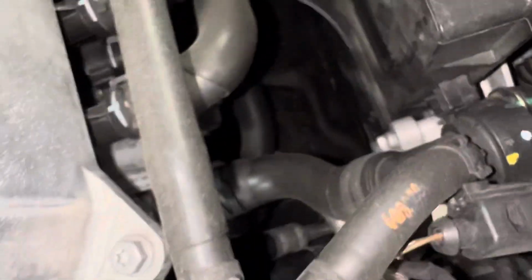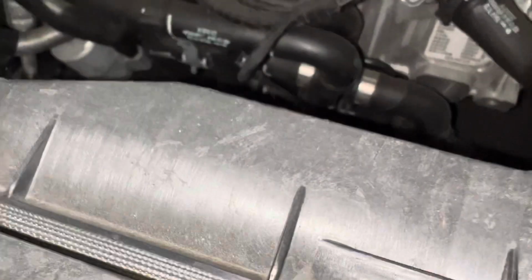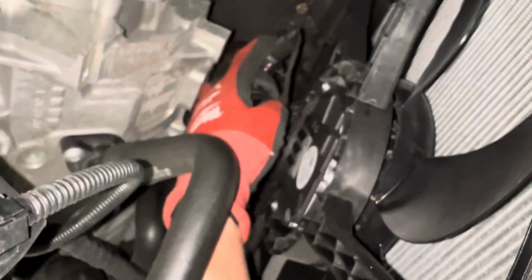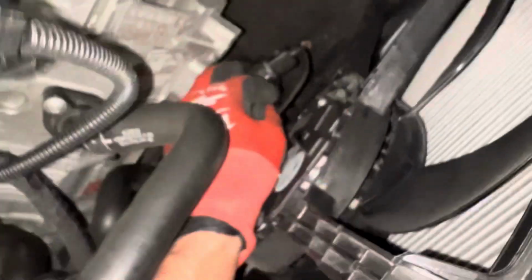And I'm trying to give you a view down there of how all the cooling on this system routes, and the different pumps. There's one of our electric pumps way down there. Always keep the electric pump low, below all the coolant, in case it runs low. You don't want your motor running dry. We have a sensor, sensing flow probably right here, unless it's sensing temperature. Now I think you'd have to look that up. I'd have to pull it out and look at it to see if it's sensing flow or sensing temperature.